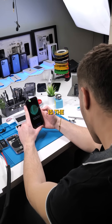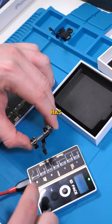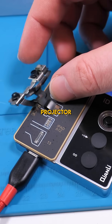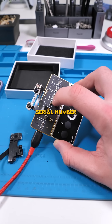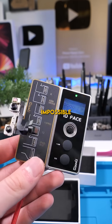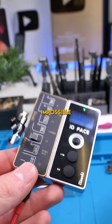The thing that most commonly fails is the dot projector, and that's where this device comes in. This device has two primary functions. The first is a quick diagnostic telling you whether the dot projector is the problem or not. The second function allows you to copy the serial number from this flex cable and transfer it onto a new one. Face ID issues are already near impossible to fix, but without devices like these, they would legitimately be impossible.